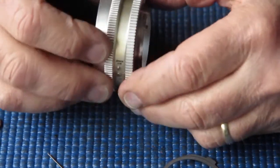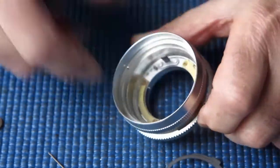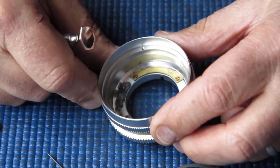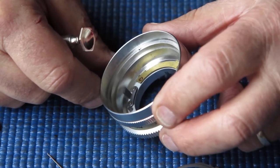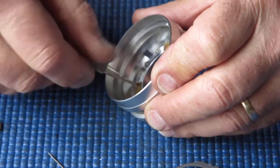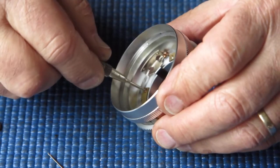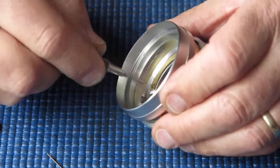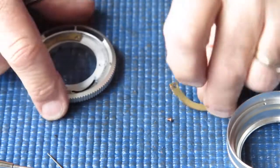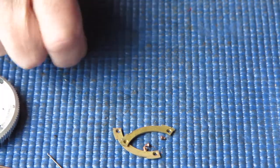This is where it's all clamped together and this is quite stiff. You can see here rust - so we know moisture has been in there. Given the colour of that I would say it probably had a splash of salt water at some stage. This is held together with four screws that hold those brass plates in place. Now we can lift that off - the brass plates and four screws, those plates clamp it all together.